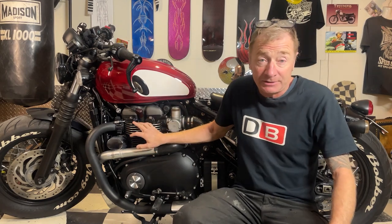At the moment the motor in here is a Triumph Thruxton motor which has got a Rotrex supercharger on it, running 9 psi boost and it's 120 horsepower at the rear wheel. But it's got the standard pistons in it - these are the Triumph Thruxton pistons which are 11.5 to 1 compression.